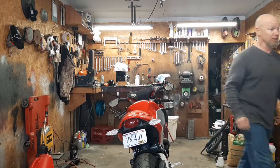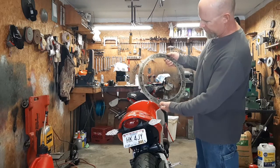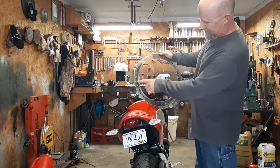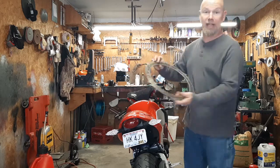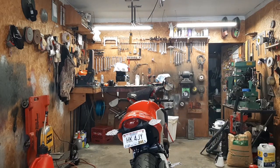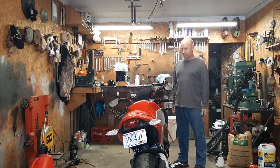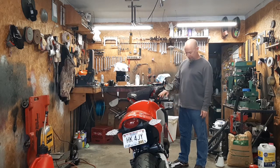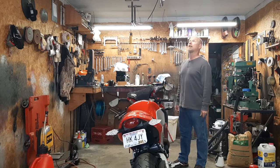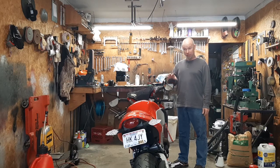When I first got the bike it had a bad pulsation in the brakes. Here's the factory rotor — I hit it with a little sandpaper and you can see a bunch of hot spots or high spots. It had a really high frequency vibration, so I took it apart and put a used eBay rotor on it. Put new EBC double-H pads on it and never had a problem until I rode it the other day.